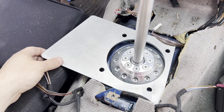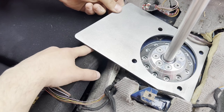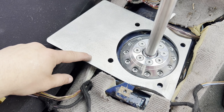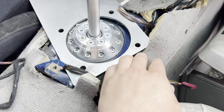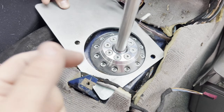After trimming back some carpet, we're running into our next issue — this bracket is running into the side of the seat. We're thinking we're either going to have to notch out this bracket, or we might be able to rotate it so it doesn't hit the seat. Rotating it creates issues though because we won't get a mounting point on that side.